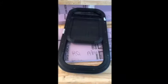So, this is the kitchen counter right here. And we're gonna have one of those little 2-foot by 1-foot windows that go right there. So what I did was I measured down 2.5 inches from this metal piece of hat up there, whatever that thing was, that is the same as those down there. So I measured that down, and then I cut the strapping out for the window frame. I scribed all the way around it to cut out the foam. And then I'll just cut the foam out, and then I'll place the frame back in there, and I'll shoot it off to the ends of these right here with a 16 gauge finish nailer.